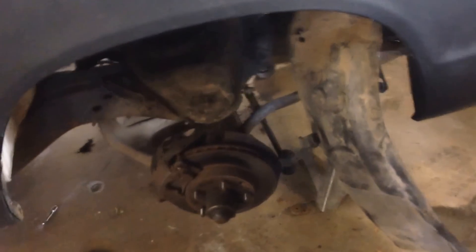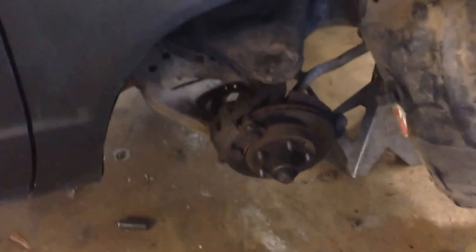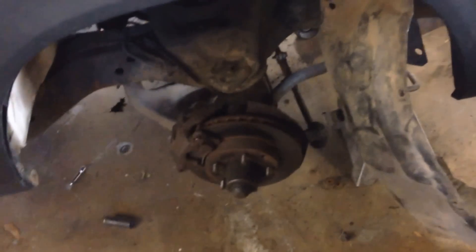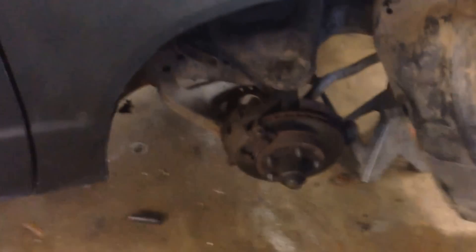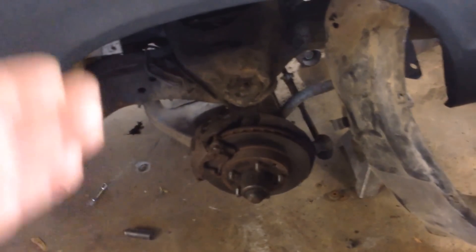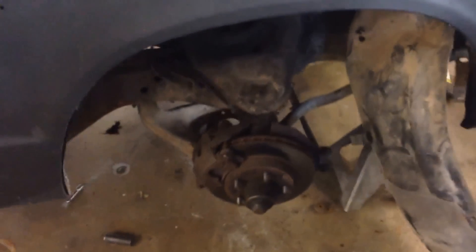Later on this evening, tonight, we're going to put the bags up. I went and got the lines yesterday, I went and got all four of my fittings yesterday, so I got everything to bag it. But I decided that I want to de-hump and probably go ahead and paint my A-arms before I do all that, so I can lay out a little bit further. All I have to do is install my drop spindles and it'll lay out like I want. So I'm going to take off the A-arms. Before we get started on that, I'm going to cut a U into my frame and box it back in. Then we're going to get started on the A-arms. We'll be back once I get it broke down.